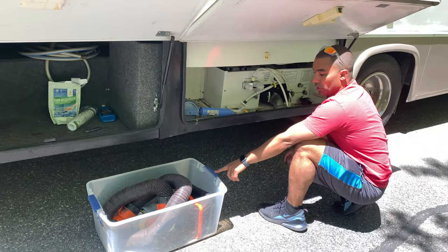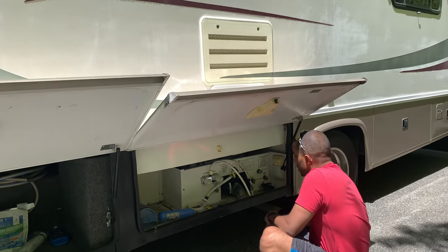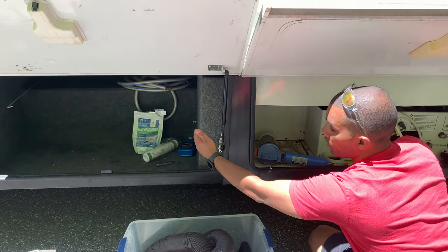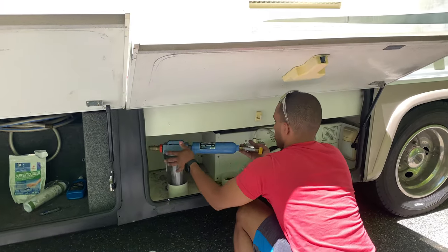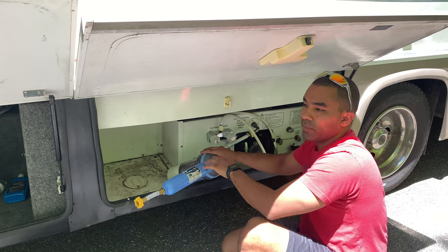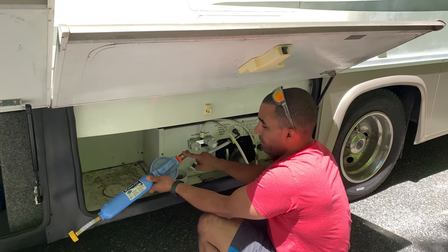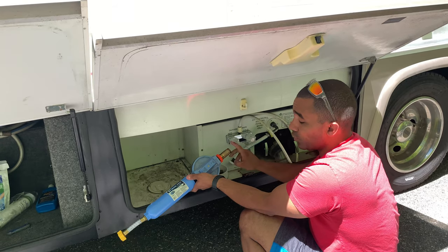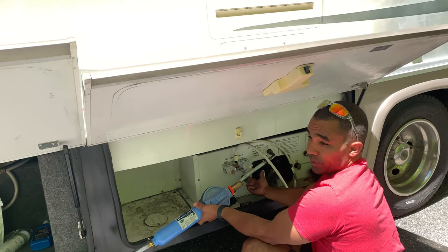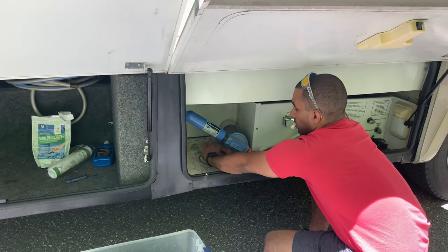Keep a pair of gloves in here. This is black water tubing — there's gray water which is shower and sink stuff, and this is black water from the toilet. What you do is get a hose from a potable water source, plug it into the spigot, plug it into here, and this is actually a regulator so you don't over-pressurize the system. If you ever see a leak from the toilet flusher, that's because it was over-pressurized — it's a very common $20 repair with a Phillips head screwdriver. I replaced this last season and here's the old one — it went bad. The hose is about an inch too long, so I don't put it in there, but if you're at camp and want the hose tucked away you can actually put it under here and it'll fit right in.